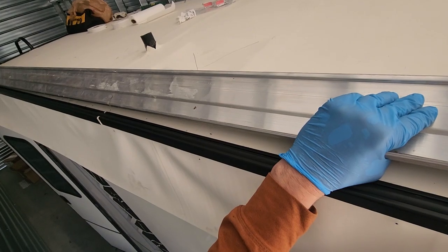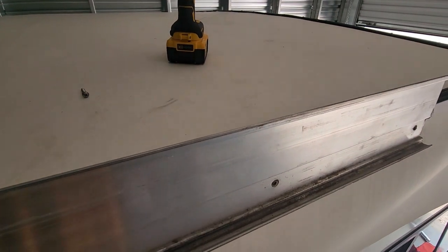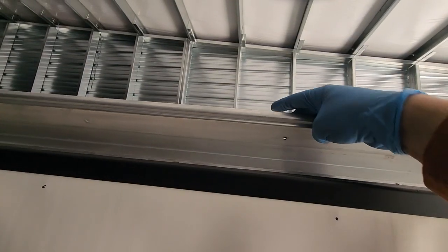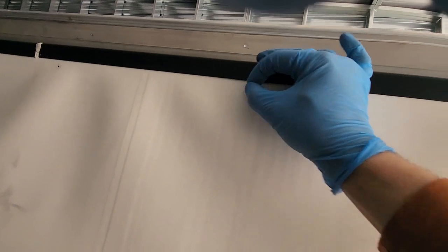The awning itself, the rolled up fabric part, sits on this awning plate, which gets attached like so up here. And one thing I'm trying to do is line up the awning exactly in this direction, to reposition it in exactly the same position. Because of these holes under here, I do not want to make any more penetrations than necessary, so I'm really going to try to line up the new mounting holes with the existing mounting holes. What you can see I did is I went along the edge here, and I felt each little bump, or if you pushed hard enough you could kind of see the relief of the hole in there. I marked a dot where each of those screw holes are,